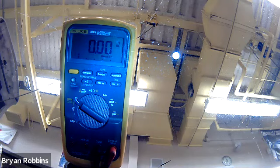If you saw a number higher than old specs that suggest 0.5 volts, that's a very high reading. Anything over 0.3 or 0.4 volts, I'm starting to suspect there may be a problem somewhere in the system. This test can identify problems with a bad starter motor, maybe a bad cable connection, or a bad battery wire that might be deteriorating. I've even seen cases where we had a slow crank condition and a high voltage drop reading, and it turned out the air conditioning compressor was seized up, putting extra pressure on the starter motor to crank the engine. A whole variety of things can be determined based on this test.